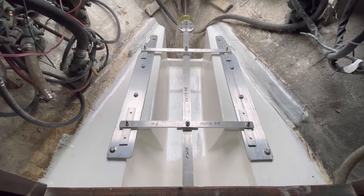Looking at the jig, we've confirmed it's 16 and a quarter inches apart — that's where the engine mounts need to be — and 17 and a quarter inches longitudinally. We'll make our marks, we'll know where the mounts need to go, and we're done with the jig.